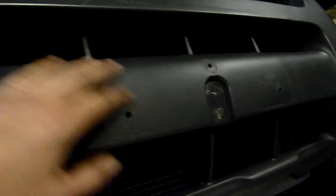Oh, that sounds good. There's a lot of oil on these exhausts — it's going to take a bit to burn off. I'm also running 10W-30, not 5W-20. 5W-20 is too light, especially for an older engine.